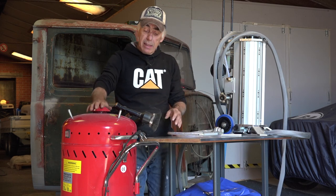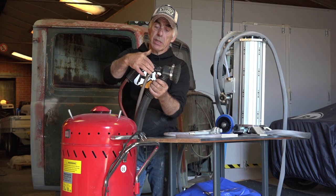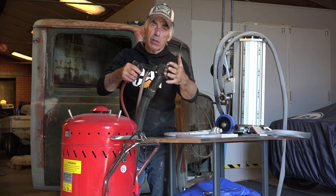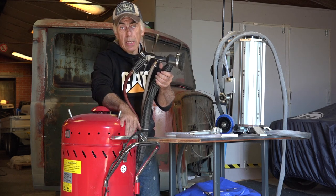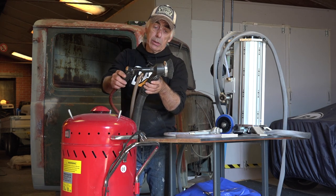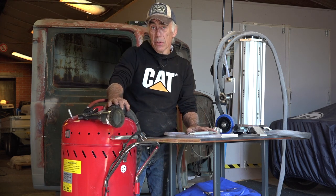The next kind of blasting system or gun is what I have here. It's exactly the same principle as this one. So you're sucking up the media, venturi system, and then the compressed air comes in and you just blow it out, just like a spray gun. The brush in the front is nothing more than a vacuum cleaner. It sucks the dust and the particles back in. So the big hose here then recycles it back into this big container. So in this case, the media is in the container and it's recyclable. Again, this is really good, and I like to work with this for small things, if you have to weld or something like this, but not to blast a complete car. Both systems are dry systems, so it means you cannot use water to get rid of the dust or anything like that.